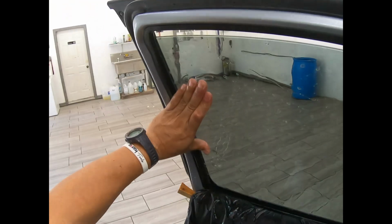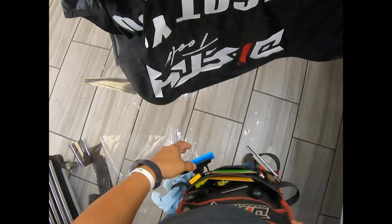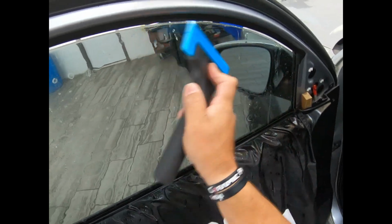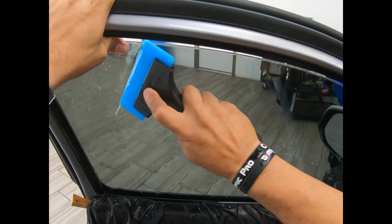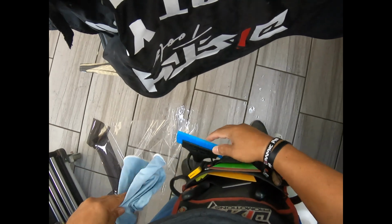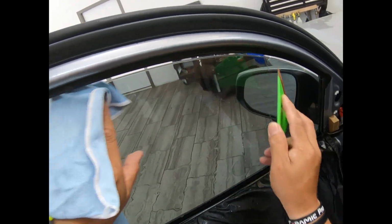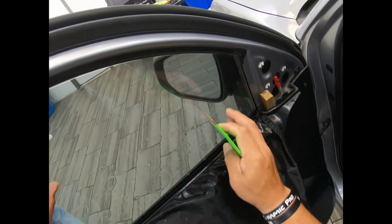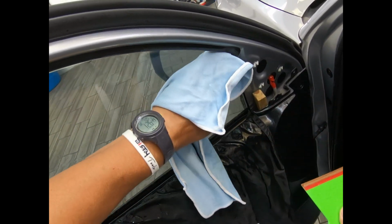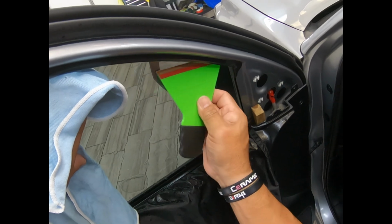So we have a lot of success. Micro as you can have it, touching pretty much, it looks like black glass. Then we're just going to finish it off. Hope you guys enjoyed the drop of film in there. Once you do the top, you can scoot it up a tad and have your micro. Come back with this guy right here, dry it so no water comes down, then slowly dry it. Raise it up, dry it. That way the lip at the top is always really nice, clear, and flat.